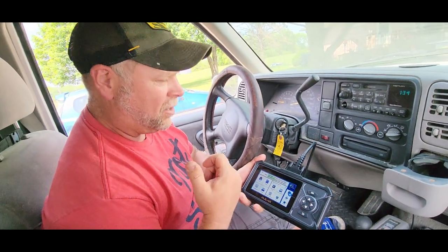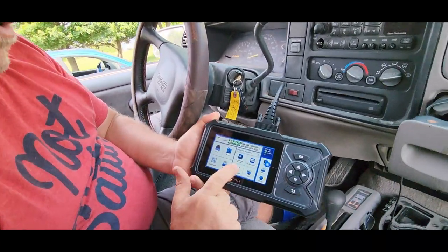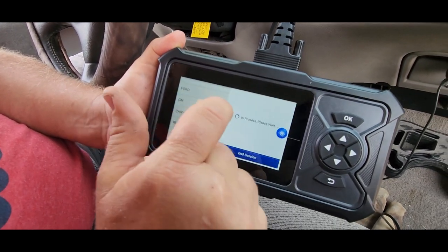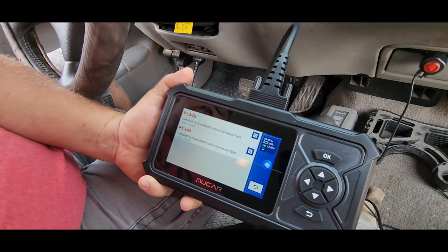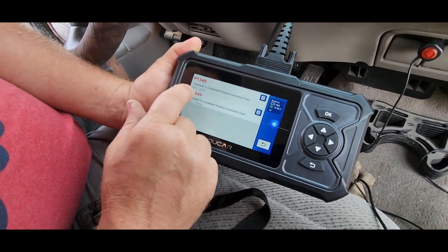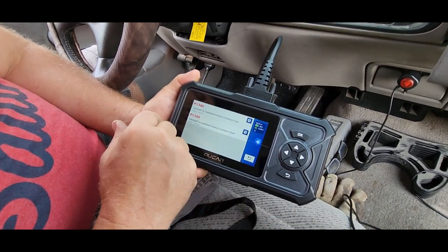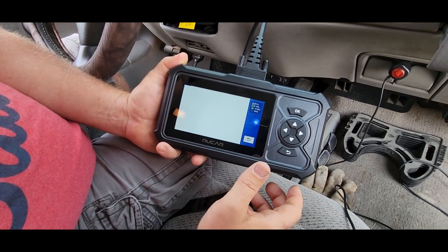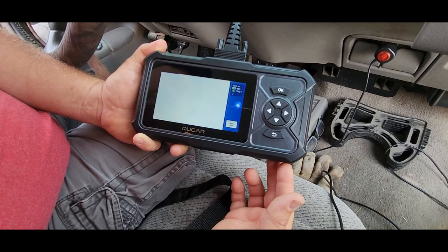We're in the one-ton dually now — you can probably hear the exhaust. My smog report has six green lights, so we're good there. I want to check the code reader to see if there are any trouble codes. We have a GM and there are a couple of codes — my check engine light is on. What we have here is a camshaft-to-crank sensor, crank position fault. My distributor cap is turned just a little bit, so I expected those codes. When these codes come up, we can click on the code and it's going to take you right to Google to explain the code and tell you how to fix it.